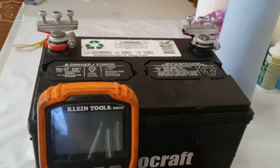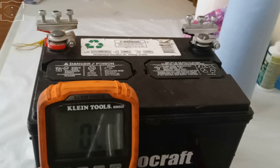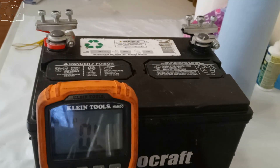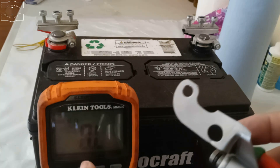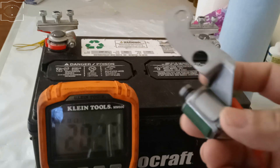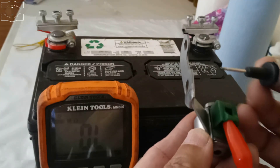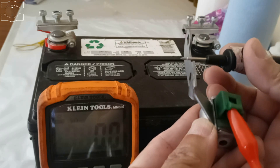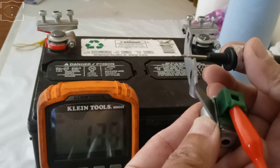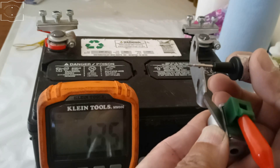We're going to test with a multimeter first, set to ohms. It's a bit dark here but hopefully it can be seen. If I get between 11 and 15 ohms, then this shift solenoid should pass this test — we still have to do the other test as well. Let's see — 13.7 ohms. So this shift solenoid is good at this point.